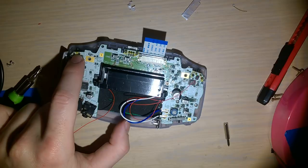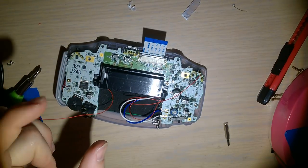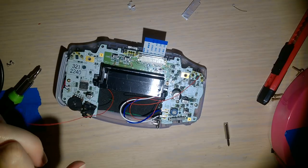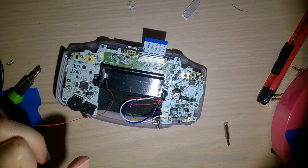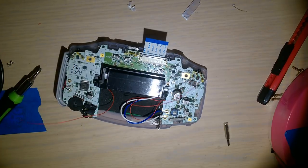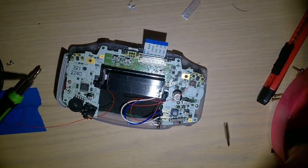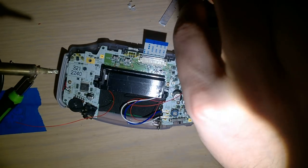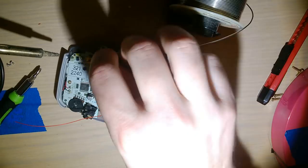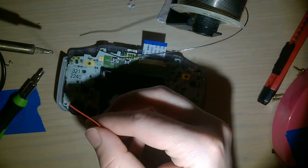The 2 outside are anchors just to hold it in place when you're physically pressing the shoulder button. You know, it's stressful on the hardware, like physically stressful. And then there are 2 solder points for the actual button. It looks like the left button is the actuation signal, and the right contact is the common ground.